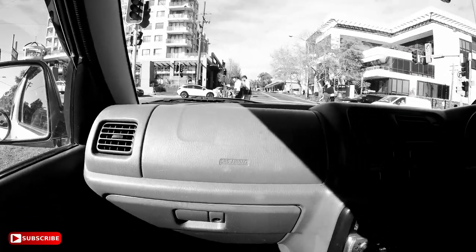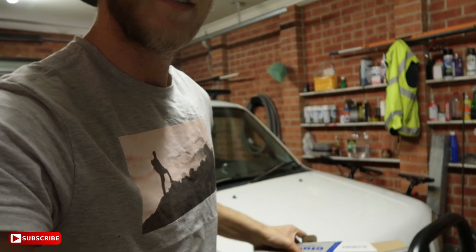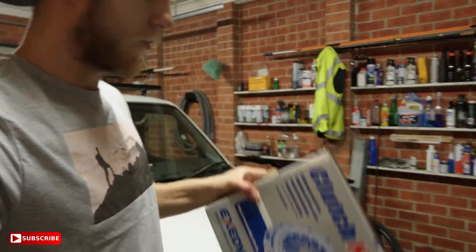So basically, the Jimny's clutch. I don't know if you remember when I first bought this car, I complained about the clutch. Gearbox feels good, clutch feels okay. Now, the clutch has gotten excessively worse. I couldn't even make it off a tiny mound the other day because it was slipping and it was just not fun. So I went out and I bought a new clutch kit. So we're gonna take the clutch out, get the flywheel machined. I'll get started on that, and hopefully by the time I'm almost done, Luke's gonna come, and then we're gonna keep on going. So yeah, get to it.